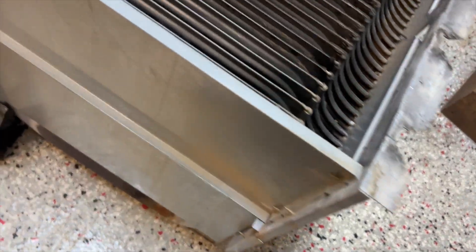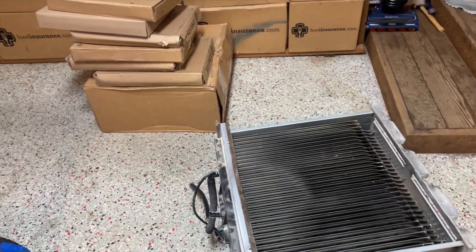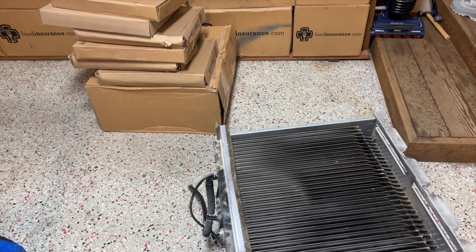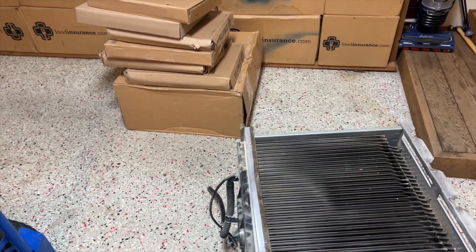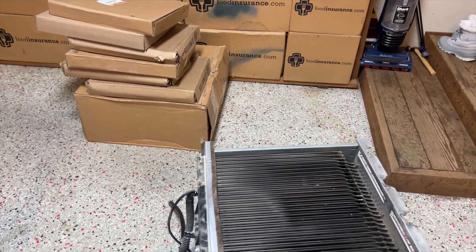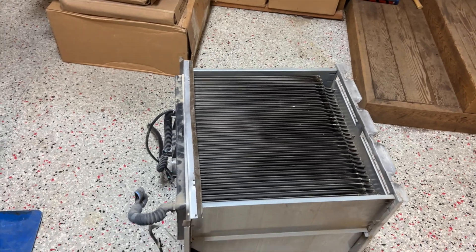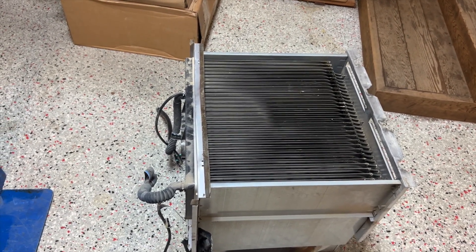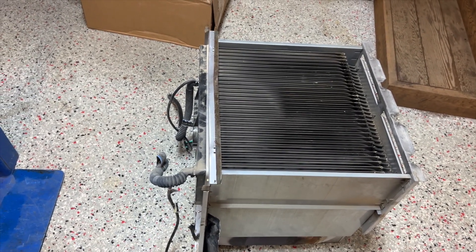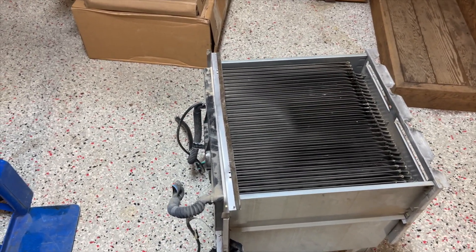That's pretty bad. We have to reassemble this — this back plate, this front plate, all this stuff we have to reuse. When you order these, and I didn't order this one, but the first time I ever did one of these I didn't know that. You want to order the plates and all that too, otherwise you have to reuse the old stuff, which I really don't like doing. It also doesn't come with any new gaskets, so we'll have to use high temperature silicone to seal everything.